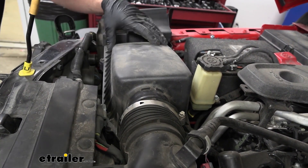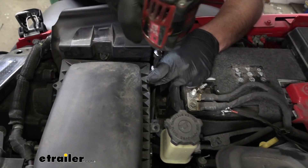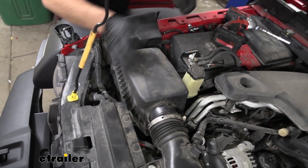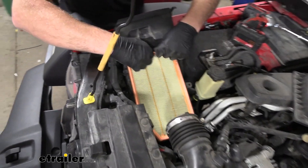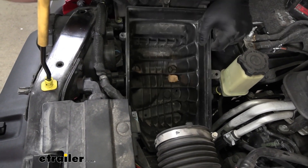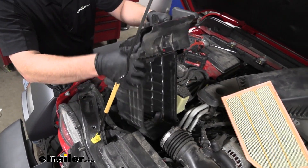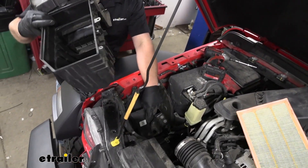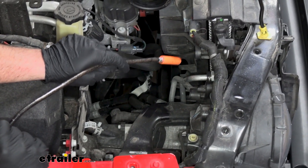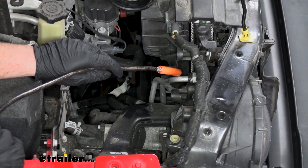The box felt pretty tight — there might be one more fastener down below, so I'll pull the lid off to see inside. There are a handful of screws around the edge we can pull out with an eight-millimeter socket. We'll lift the lid off and pull our filter out. There actually wasn't a fastener in there, but removing the lid made it much easier to maneuver and we were able to pop the box out. Now we're going to have a lot more room and be able to see what we're doing.